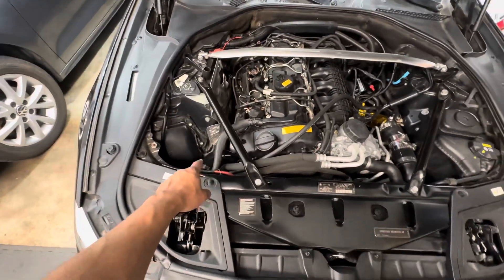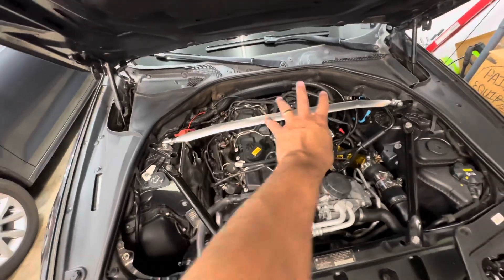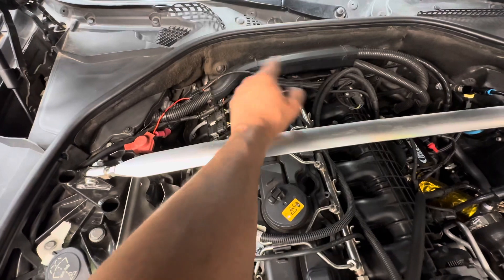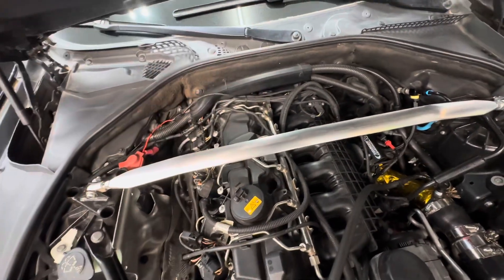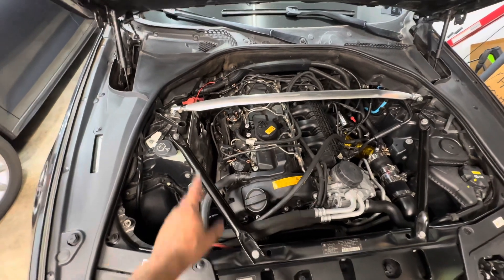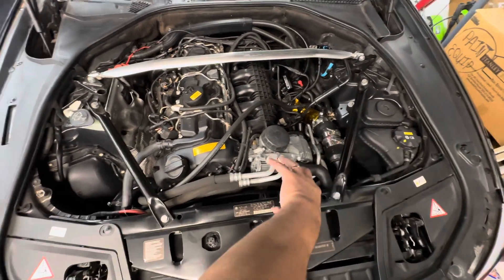One way you could avoid having all that smoke coming out of the air filter — this is unique to my setup, but the same thing would happen if you hooked it up at the turbo inlet pipe. If you have the factory setup with the airbox on top of the intake manifold, there's a connection point where you can disconnect it from the MAF slash airbox area. There's a clamp around there — disconnect that and put the bung right there to pump smoke in. That way you wouldn't have those issues. For those with an N55 with the intake coming up by the front, you should be able to just unhook the inlet pipe from the airbox and pump air from there.